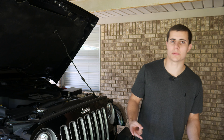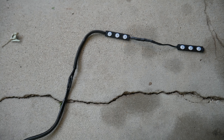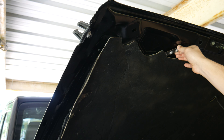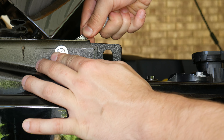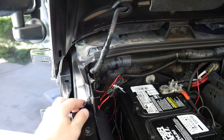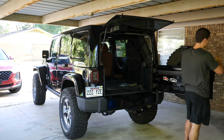Next is project two: installing two lights under the hood. I've already made the wiring harness — we have our two lights up top, positive and negatives go through a wire grommet which will go under the hood liner, then when they come out at the bottom our positive goes through a switch, inline fuse, and connects to the positive terminal of the battery, and our negative runs straight to the negative terminal. To install, I'll run the wires up behind the hood liner, clean off the mounting surface, stick two lights on, then hook everything up to the battery. To mount the switch, I'm going to bolt on a spare piece of metal from my bumper and poke the switch right through. The lights are up there, wires go down through the grommet — I left enough tube so we can flip the hood all the way back — and the switch activates the lights.